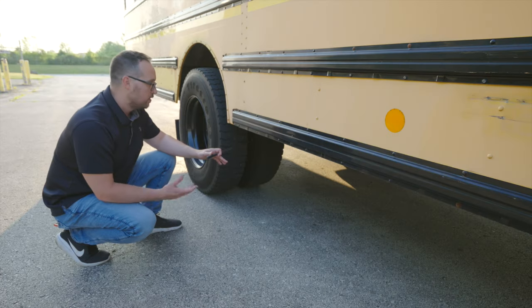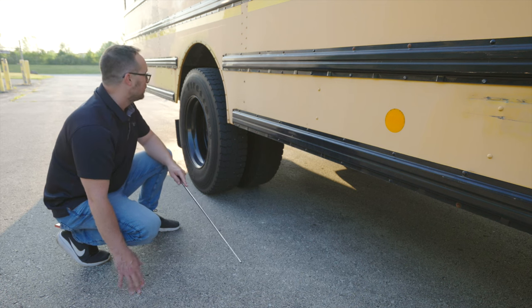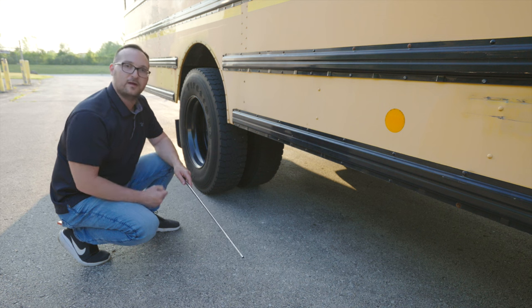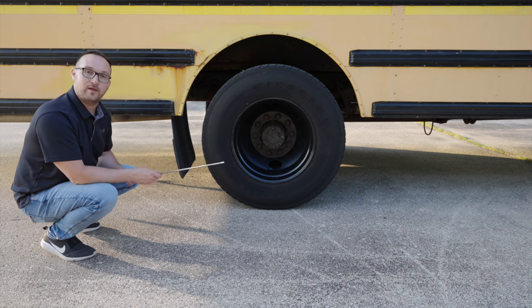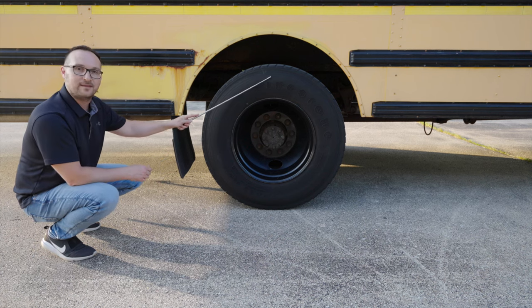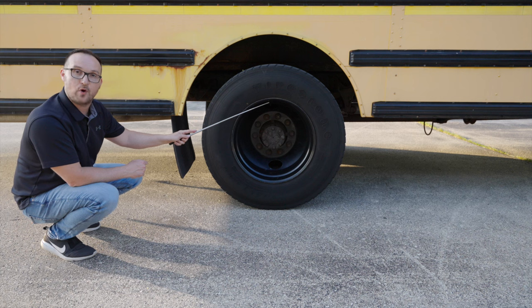If there is, you would get a tool to remove them safely. Now we will inspect our wheel, starting with the front of the wheel and the tire. Our tire wall, it's not broken, not cracked, unsecure, there is no cuts, no leaks. Our rim, it's not broken, not cracked, unsecure, there is no illegal welds on the rim.